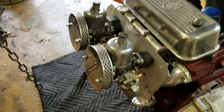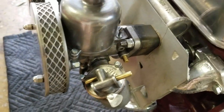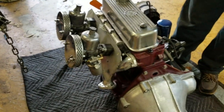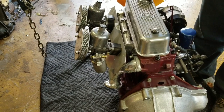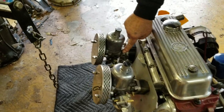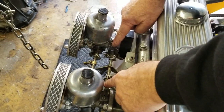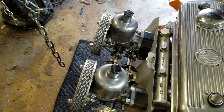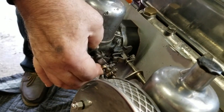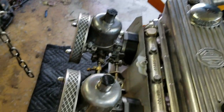Because it's a street performance engine, I pre-adjusted the jets down 65 thousandths, which should be a fairly good starting point for fuel mixture for initial startup — that will be close. Chris will have to adjust the idle speed screws and also the fast idle screws, which are down under here. When we activate the choke, those need to abut the cam on the choke linkage. Chris will be able to do that.